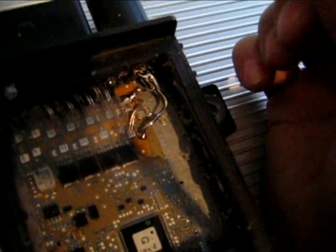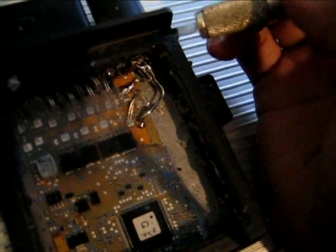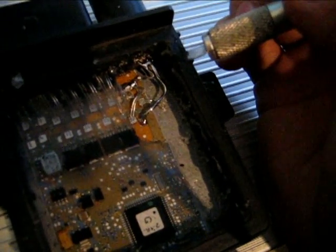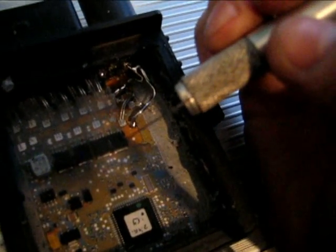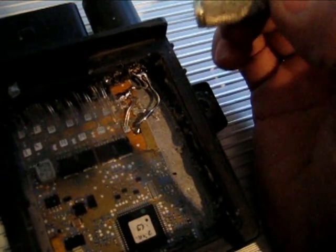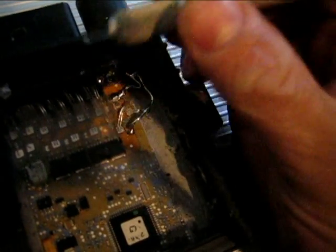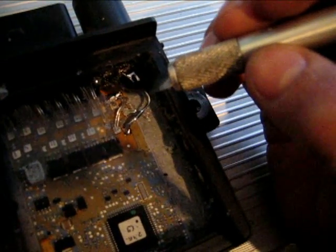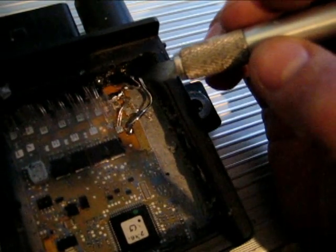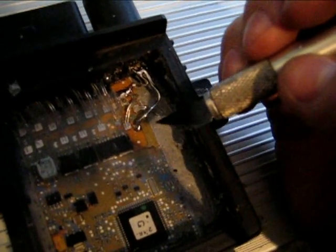I'll try to take a picture and post it with the video. I found out it wasn't only two of the wires coming from the 175 amp fuse on the large power connector — it wasn't only two, but all of them were broken. That's what this module was saying when we read the code: 'main supply.' So I thought there might be a way to fix it. There's a lot of goop, a silicone gel, and we have to remove all of that. There are two power planes — one here and one over there — linked together, and usually there were six or eight wires coming from the jack distributing 12 volts to all the MOSFETs.